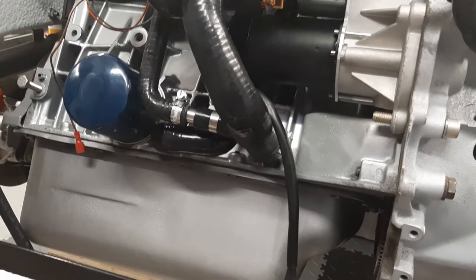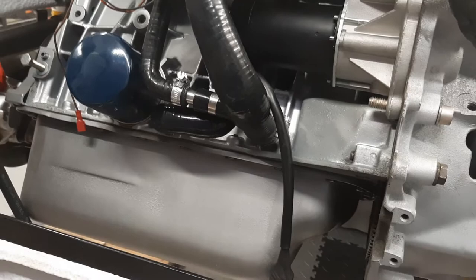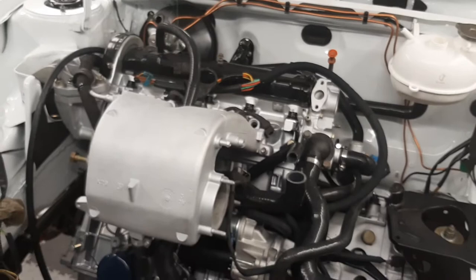On the eight valves, they've got a funny little valve inside them. When I've put aftermarket oil filters on the Peugeot before, I've lost my oil pressure. Put the genuine one on and you get it back. So the engine bay is coming on quite quickly, as you can see.